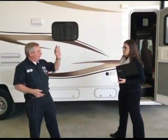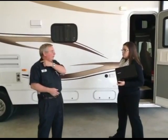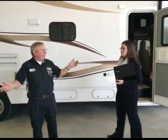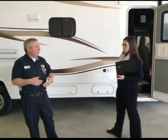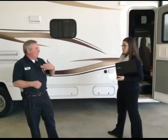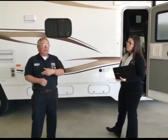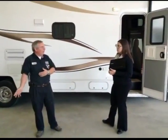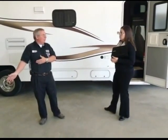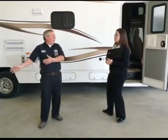Right. Or if you have a heat pump, you run the heat pump. Right. Because ultimately, exercising your generator is what's going to make sure that all those moving components are still operating properly. It'll cycle new fuel throughout the line. Yeah, the majority of the coaches out there, unless it's a diesel coach, use fuel out of your tank. And you might have a 30-foot piece of quarter-inch line that fuel runs through to the generator. And if you leave it set, that turns into varnish eventually.